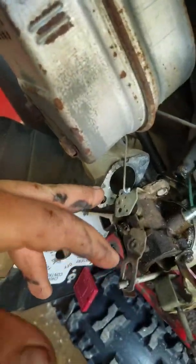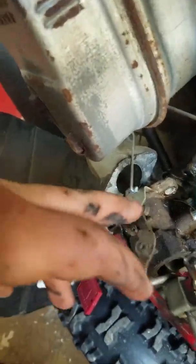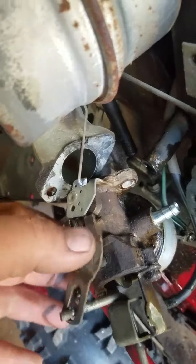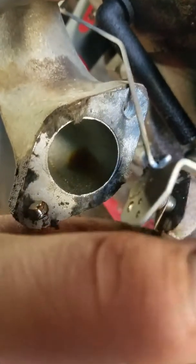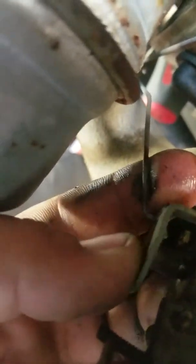Got the two bolts out, marked it with a little bit of paint marker right there so I can remember. A few lines off — a little bit of fuel dripping out. The throttle linkage has a Z-bend to it, so when you do it you've got to push down and then pull it up and off. Hold one end with your fingers, drop it down, bend it and twist it, and pull it right off. Simple.